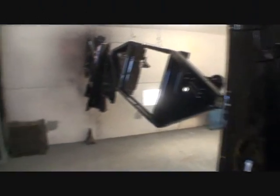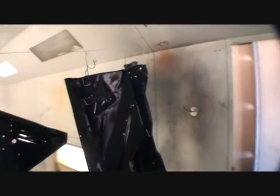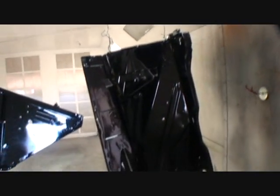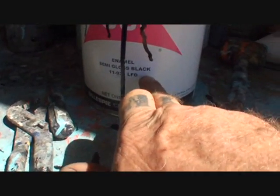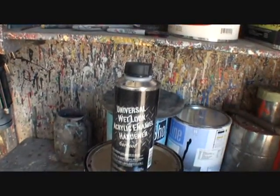Once you've applied your last and final coat of paint, this is what you'll have — brand new, restored, factory-original parts for your restoration. We did not use any sealer, no primer, no epoxy primer — nothing. We did it just like the factory would have done it, painting right onto bare metal, but using the proper paint to do that. This is a semi-gloss black direct-to-metal industrial paint — it's a beautiful, very strong, lasting paint that will hold up for a long time. Always remember to use the required additives.